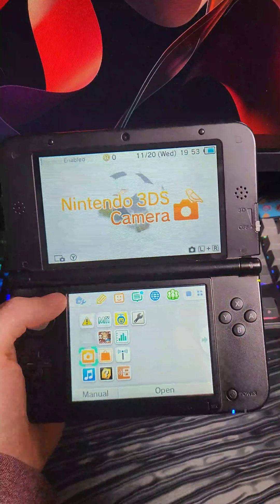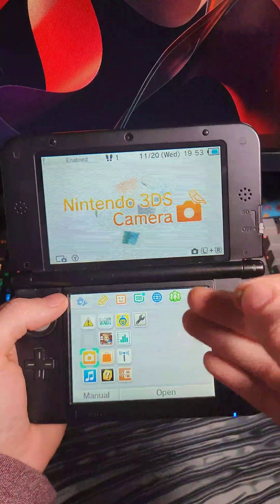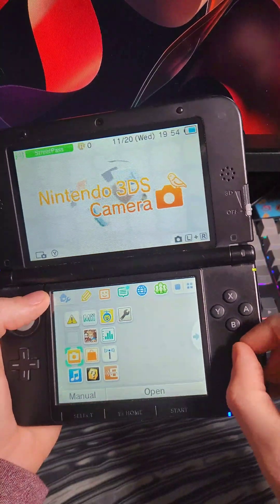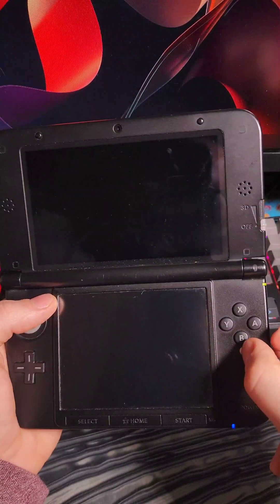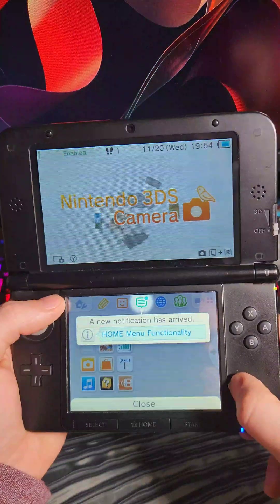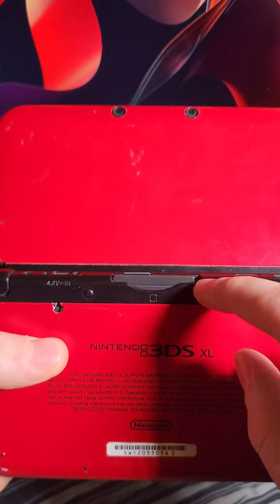For this next part, take the small magnet and find the sleep sensor on the 3DS. If you have an old 2DS, you have a manual switch for this, so you don't need to follow this step. On the old 3DS XL, placing the magnet right about here will find the sleep sensor, and when you remove it, it won't think it's asleep anymore. Now power down the console and make sure the flashcard is inserted in 3DS mode.